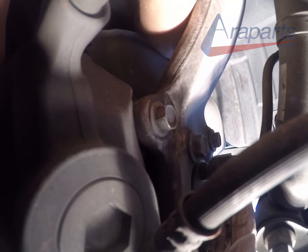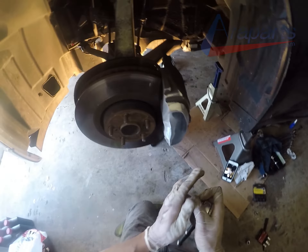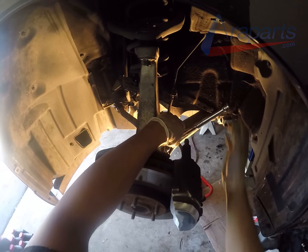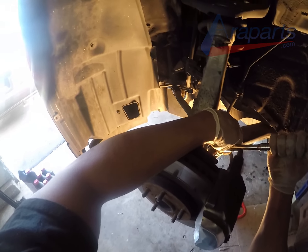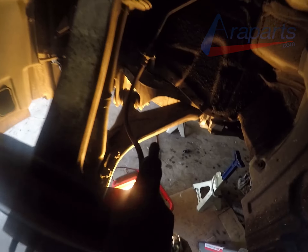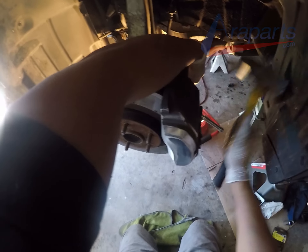As you can see from this current shot, these are all the bolts that are coming off. You can see the caliper bolts and also the wheel hub bearing bolts. All of the bolts are 17 millimeter, all the same size. You can see how I'm using the hammer to remove that 17mm bolt with my ratchet. I don't always recommend that method — this ratchet is taking quite a bit of abuse and you can damage the mechanism doing that, but it's just a technique I used.